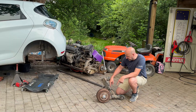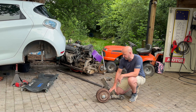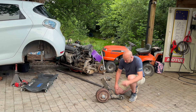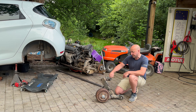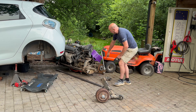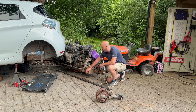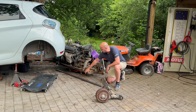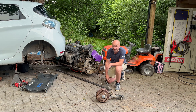This is the Renault Zoe's rear axle that I've taken off. I have already sliced off the rear hubs. The measurement from here to here is two and a half inches longer on this MGF than the measurement here on the Zoe. So basically my mounting points on the Zoe - I can't just mount into the same place. I've got to go inboard a bit, and that's the plan. I can see I've got enough room to be able to do that.